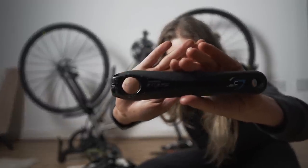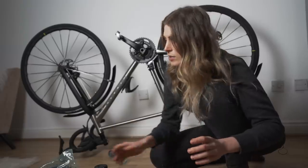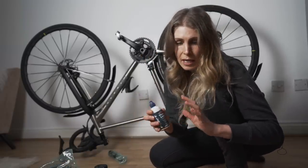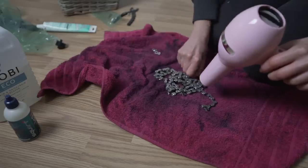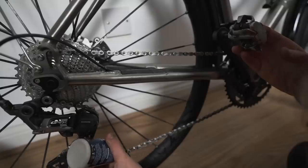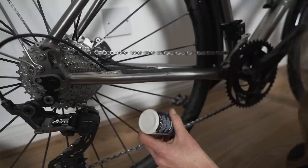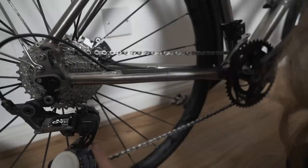This power meter I've had for about four years. Everyone always asks me what power meter I have — it's the Stages left-hand crank. I absolutely love this thing. It has just been one of the best training tools I've had, and I'm very sad it's not on that bike anymore. Now, with Squirt, you apparently completely clean all the grease off your chain, let it completely dry, then put one coat on the inside of the chain and leave that to dry for a couple of hours. Then do a second coat a couple of hours later and leave it overnight. That should set — it's basically a wax. So we'll see.